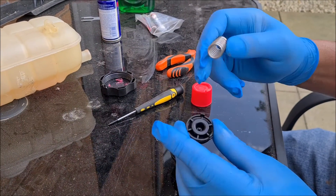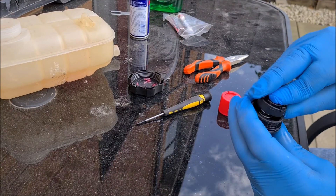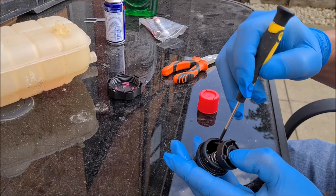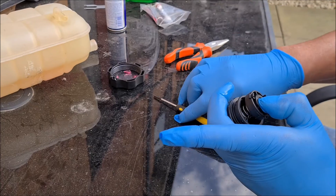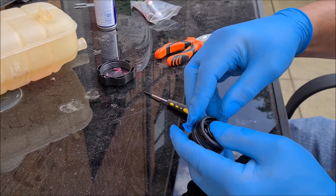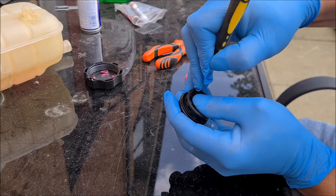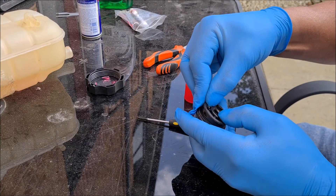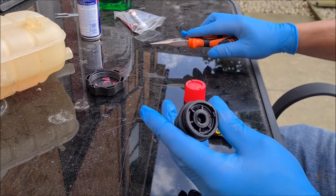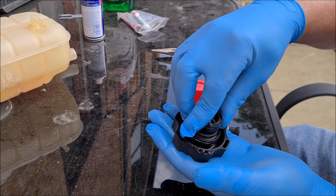Furthermore, when we took it out we saw these grooves. Put that in like that, put that on there like that, and we press it down — you see the grooves, it sort of locks in. You see the cut-out there, just there. Line it up, press it down, whichever way it slides in. Once you get it in, twist it round clockwise. Make sure all the corners get in. Press and turn — and there it is, it's locked in. Now we could get a bit of emery paper, clean that off, and glue that back in there.